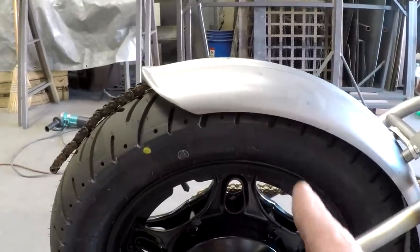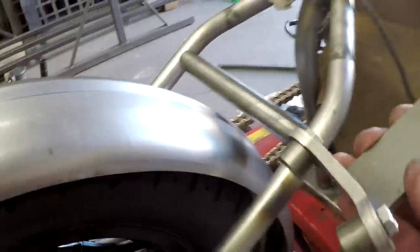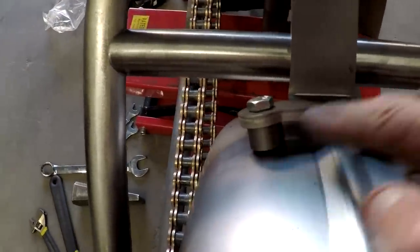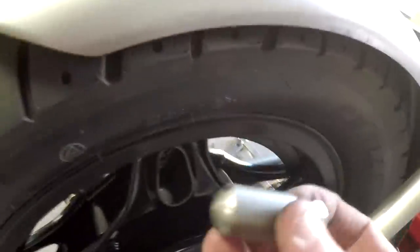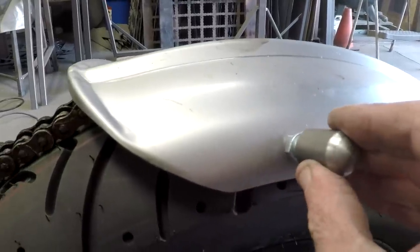That's about how I want the fender on the bike — I might go a little bit shorter. Check this out: from TC Brothers, this is a universal bracket for ribbed fenders. You can see how the fender has a rib down the middle — I'll weld it right here, figure out where I'm keeping this bar, and weld this to the bar. But I've got to get the seat and tank on to figure out where the bar should go. Also from TC Brothers, it's a universal fender strut kit — this will go here, I'll drill a hole in the fender, bolt it in, and weld this round bar to it, coming down the same way at the other end. That'll be the rear fender strut.